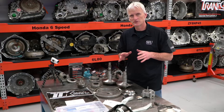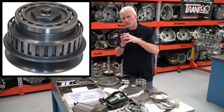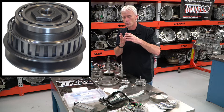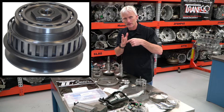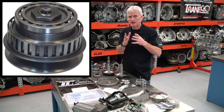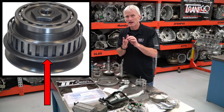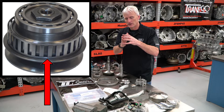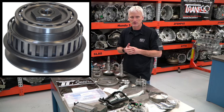Another thing to look out for on the JF-015E: where the pulley assembly drum fits against the pulley itself, the reluctor ring that the speed sensor picks up on is wedged in between the drum and the pulley half. Over time they might split apart a little bit, and that lets the reluctor ring spin with no grab — you'll get speed sensor and gear ratio codes. So you want to press that back together when you rebuild this. Most techs will either take a TIG welder and tack it, or heat it up just enough to get some solder to melt onto it. It doesn't take much force on it, but when that drum and sheave separate, there's no pinch, no grab, and it'll cause a failure — set codes, put you in fail-safe, all because of that.